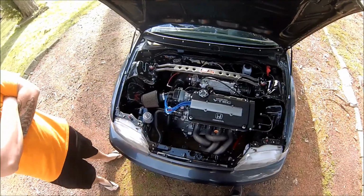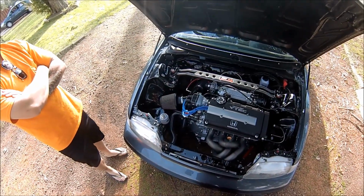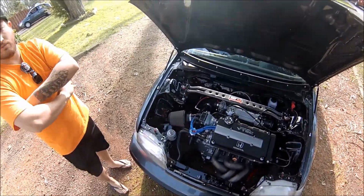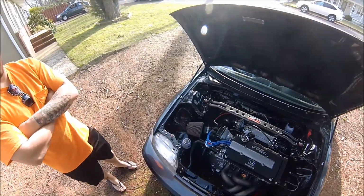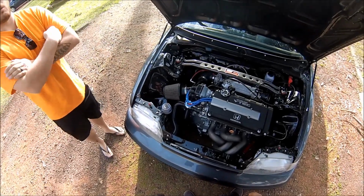Okay. You can add more if you want, but you'll have a problem if you're going to start your car and it won't start up. It's most likely your engine grounds. Like if it fires up and shuts off, it's your ground. I ran into a situation like that once. Common problem, especially when the thermostat one. People forget to put that one back on.